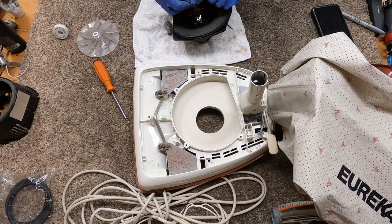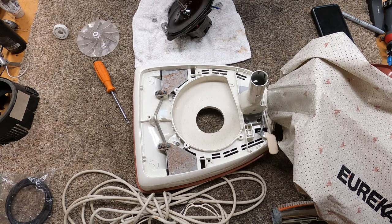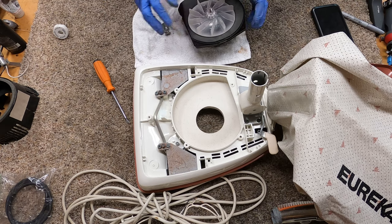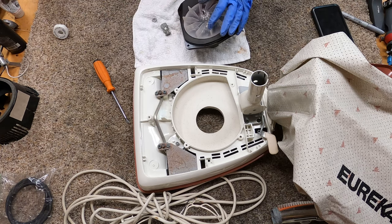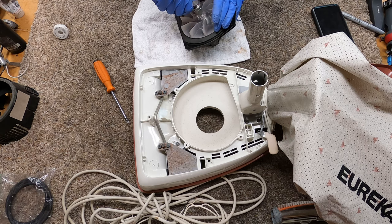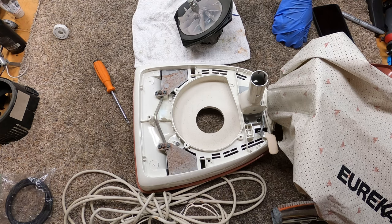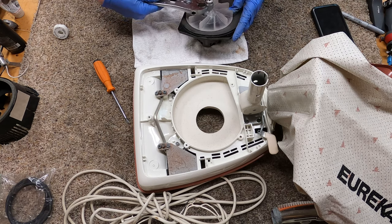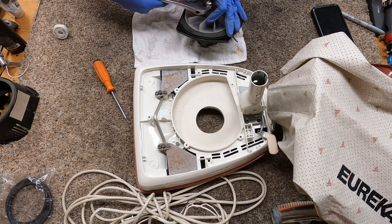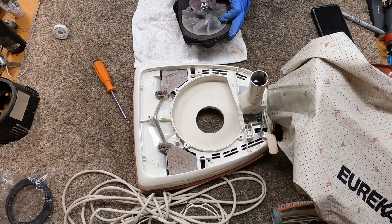This is a short fan, and any time you do one of these fans make sure you have this part — it goes on here. These fiber washers are really picky in terms of which way they like to be oriented. I washed this fan again; it seemed good so why not. Put it on hand tight, then take a wrench and give it a little bit of love. It is a funky American size, but there we go — nice and tight.